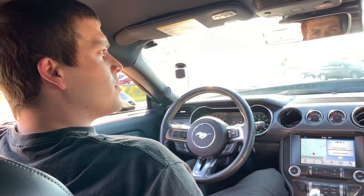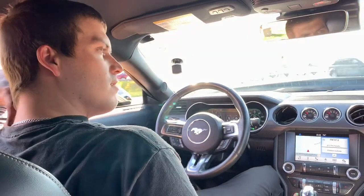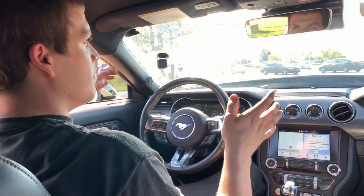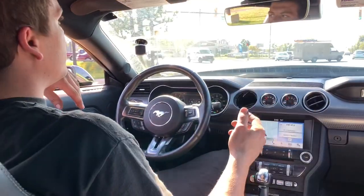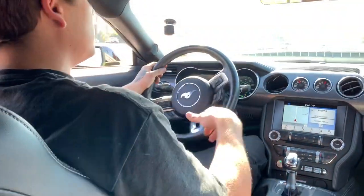I was a little worried doing the coilovers. When I was looking at them, I'm like, this car's going to ride like crap. Terrible. And I put them in there. We adjust them all the way down so we keep the ride height, and the rebound's still kind of in the middle. And, dude, it rides even better than it did with the other one. From back here, zero vibration. We're on the stock wheels now, but even with the skinnies in the front, there was nothing.